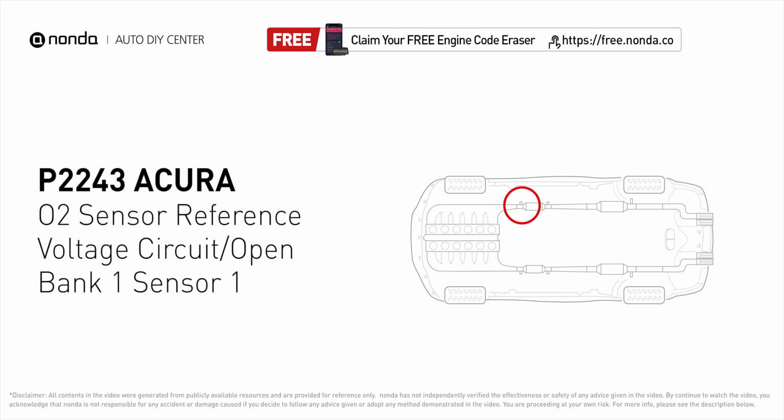It means that the oxygen sensor reference voltage to the sensor is open, and this will render the O2 sensor's signal return inoperative and cause the ECM to go into open loop fuel control.